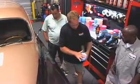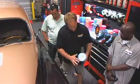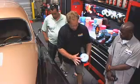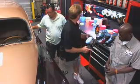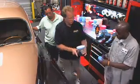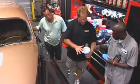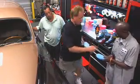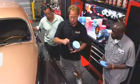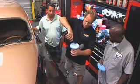And a couple of things: now the entire face of this pad is lubricated. Now this is a cutting pad, and let me just show this to you. Run your hand across there, Terry. Feel how sharp that is? Yeah. That's the difference between a cutting pad, a polishing pad, and a foam pad: how aggressive it is. And you don't want to bring a dry cutting pad down on paint that's scratch sensitive because you could mar it. Even though you're going to polish it, it's just not a good practice.